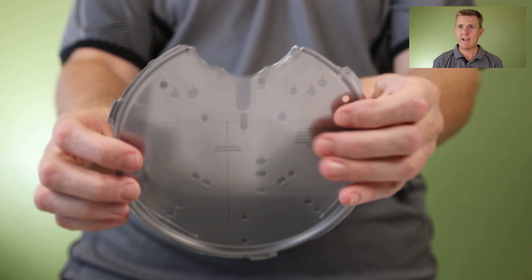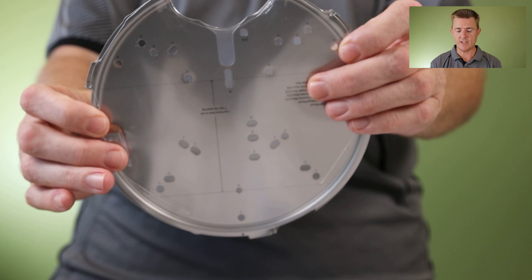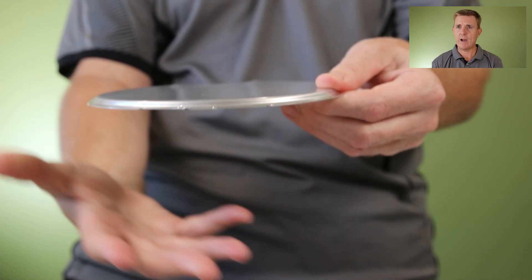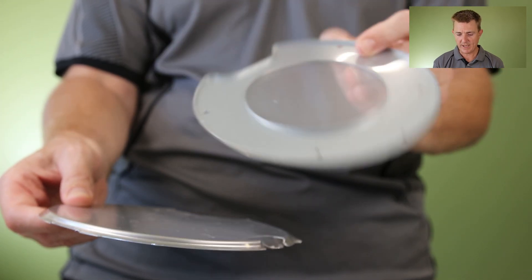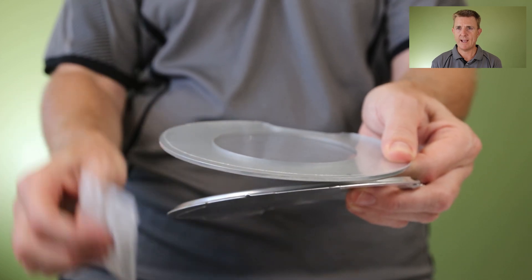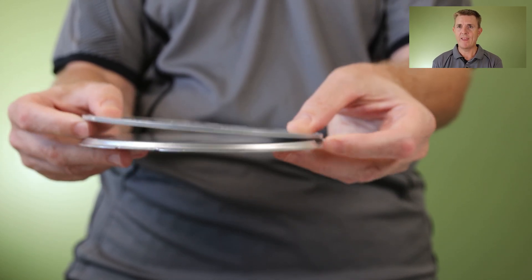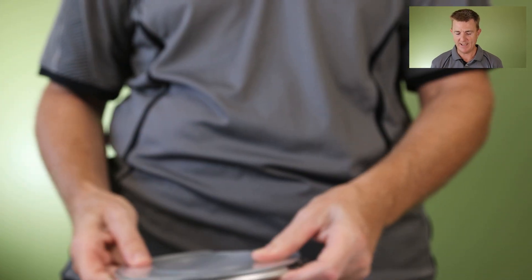Then you're going to get your universal mounting — this is pretty much the same size as most of the U6 things like the U6LR and the U6Pro. Plenty of screw hole options on there. This will go onto your hard flat surface. If you have the ceiling tile mounting, you'll use the other plate above it, and we'll use those long bolts to pass up through the ceiling tile so that the tile is sandwiched between the two plates. Then you can put the tile back into place and bring the unit up to it, twist it, and clamp it into place.